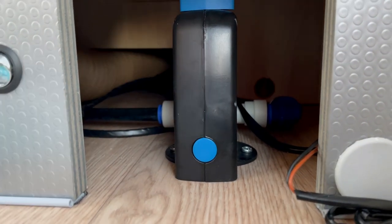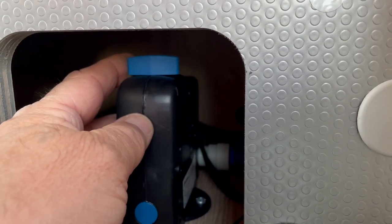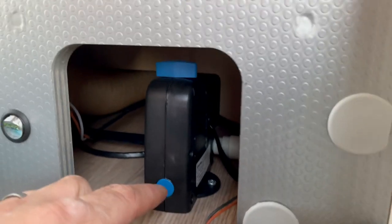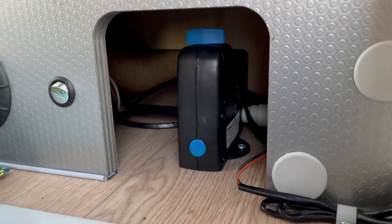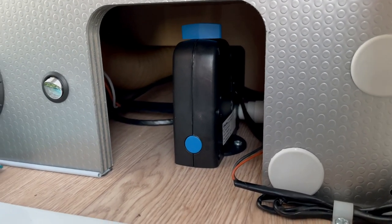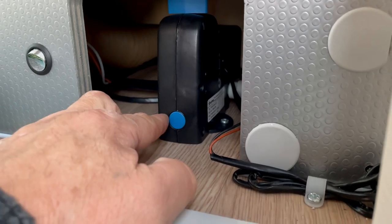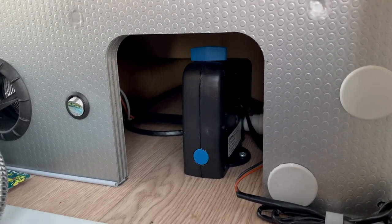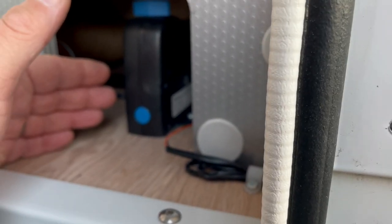That is a great safety mechanism. What I didn't know is that when you come to fill up, you turn the tap to the opposite position so the water doesn't flow straight through, and you push the button back in. On this occasion, this button would not go back in — so when I was filling up, it was just filling the boiler and fresh water tank, but when I put the pump on and pressurised the system, it just released all the water out of the boiler. I tried to push it back in and it would not engage. I checked the manual and found that this will not push in when the temperature is three degrees or below — it has to be at least seven degrees.